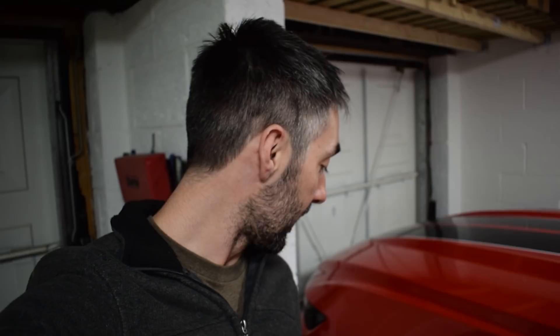I'm also going to be painting the Brembos at the front. I did mention I'm going for a red, black and white color scheme. Now red is the obvious choice for calipers, but with white being kind of my accent color, my highlight color, I'm going to go for something a little bit different — this could possibly be the biggest mistake ever, painting brake calipers white, because what goes with brake calipers is lots of brake dust. So I've got some Foliatek brake caliper painting kit just for the front. The rear calipers are just standard, not fancy six-pot Brembos, so they're going to stay black, whereas the fronts are going to be white. I've also got some little high temperature Brembo decals to stick over the top.